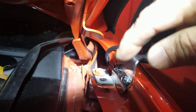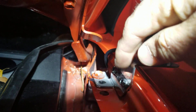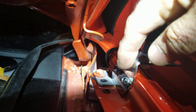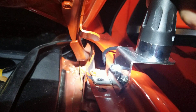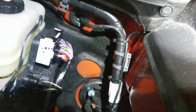That sealed connection will prevent rust from digging into the metal that lost its paint during drilling. I also applied a layer of the same sealant behind the bracket. I often use rubber tape to form a cushioning layer, which makes the metal bonding very solid. Then I run the coaxial cable down and through here.